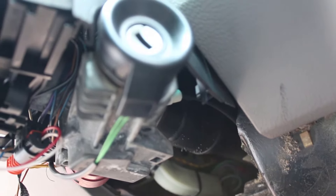It doesn't do anything — the key just spins. Let's try another one because I've got three keys, and I've got this little key fob. The key fob does nothing. There are no stops, no on/run/start mode. So apparently there's something going on with this key cylinder, and that must explain why there's one in the back.